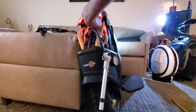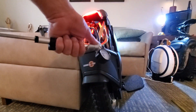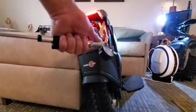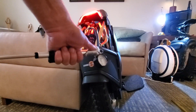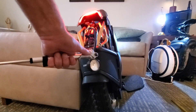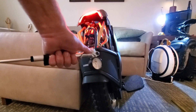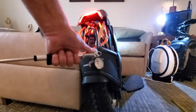But if you weigh over 150 pounds and you think having 100 pounds in there is enough, you're wrong. Notice this one — now that the upper has been more inflated, the lower is up to 175. Remember, I only started with 100 in that chamber. So letting the block out and bunny hopping a little, I end up with more pressure in the bottom.